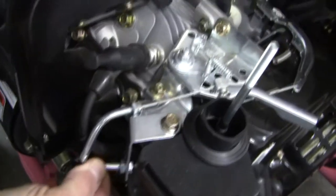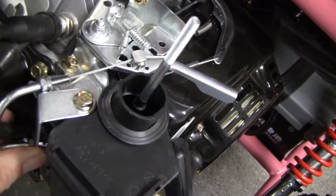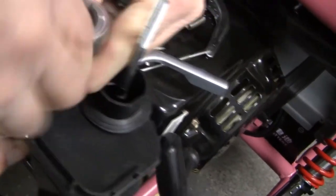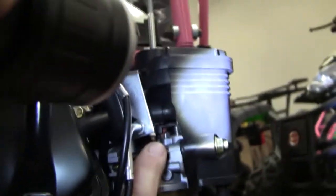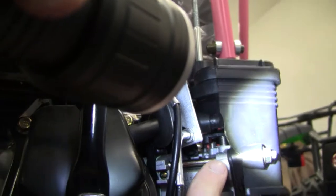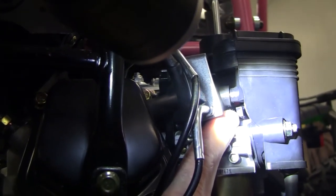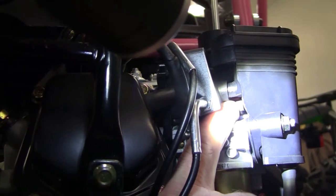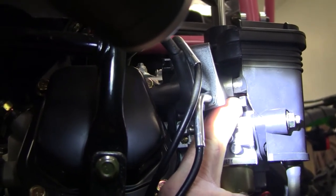So what we need to do is rotate this a little bit clockwise. Once we get it more clockwise, we can test the choke and make sure that it does not move. I would go all the way over and just tighten it like this. Once it's snug, what we want to do is look at the black plastic piece rotating as we pull the choke out. That black plastic piece — we want to make sure that it is fully choked, moved all the way counterclockwise, all the way to the right. As you can see, it does not move when I push up against it.